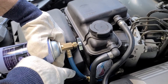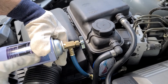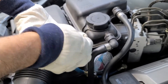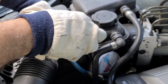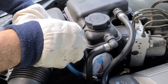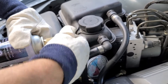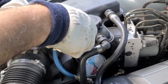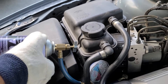The refrigerant is still not flowing because that needle is blocking the way. As soon as I open this valve the refrigerant will flow to the pipe and then go to the low-pressure port — but let it go slowly. You can hear the sound — it is flowing. You can see the gauge is moving, but this is not the actual reading; you need to close it and then read it. So I need to add more. Always let it go slowly and don't overcharge your AC into the red area. You can shake it or take the can downward to make sure it's flowing again, then close it, give it a rest, and read it.